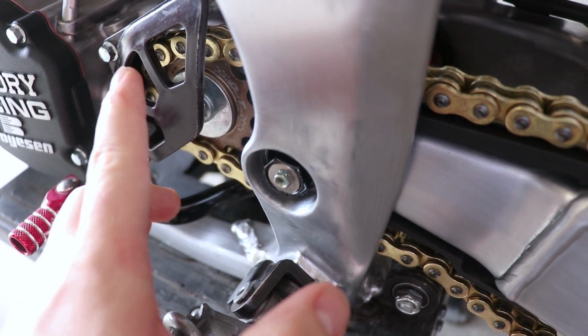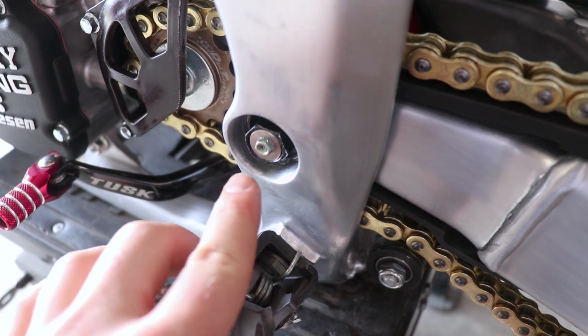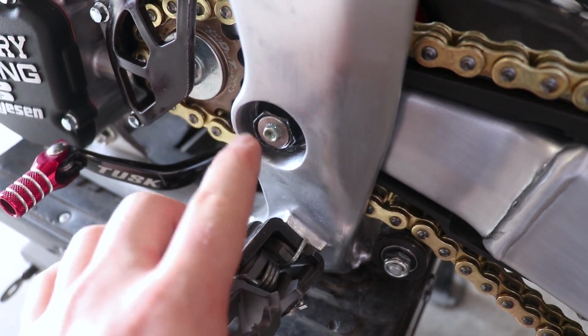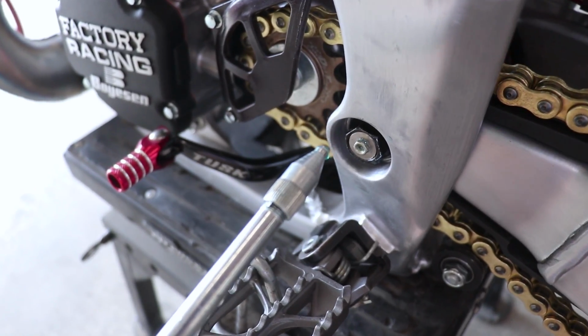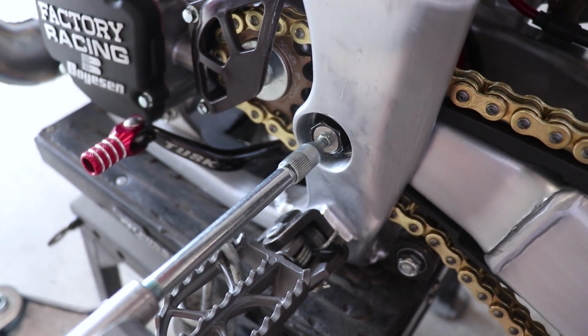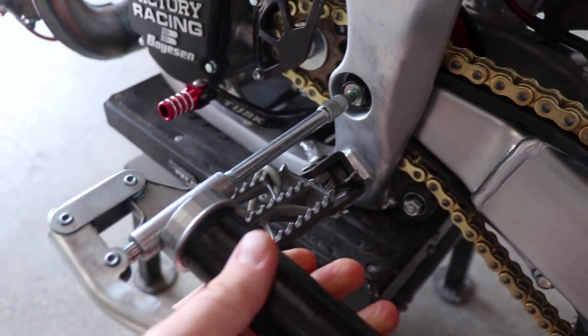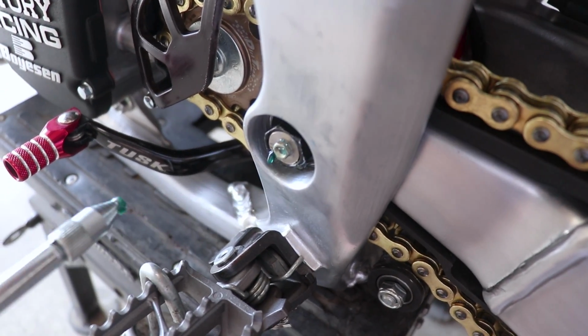As far as everything in the kit, you're getting the bolt, the spacers, and the grease fitting that you just hook up to your grease gun to shoot grease through. This is the fitting right here. It's pretty straightforward. You just press that tip into the end of the bolt, give it a couple pumps, and just like that, your swing arm pivot bearings are greased.